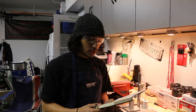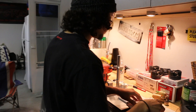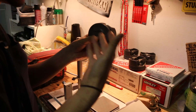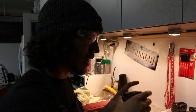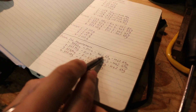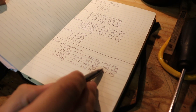Off camera we went ahead and removed material from two of the other pistons. Piston number one is our baseline — it was the lightest out of all of them so we didn't have to remove any material from it. It came in at 462.65 grams. Piston number two was the one where we had to remove the most material.